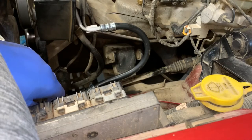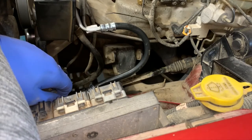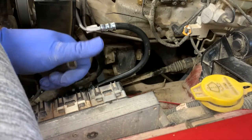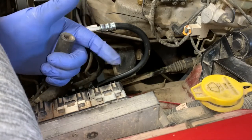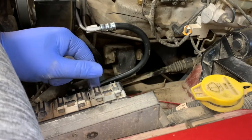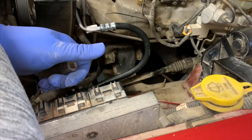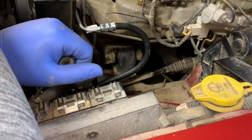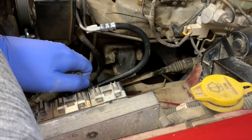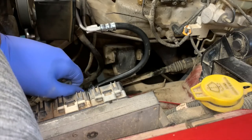They contributed to the Jeep breaking yet another exhaust manifold. I have a wall of shame of broken ones. I've got a Headman that tore. I've got, actually I threw out the factory one that was already broken when I got it. It cracked at the welds. The Headman, when I say it tore, somebody ground their welds too much and then there basically just wasn't enough steel. And when it got a bit of strain, a lot of heat, it tore itself right open.